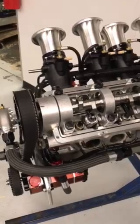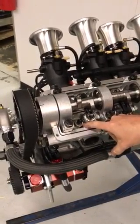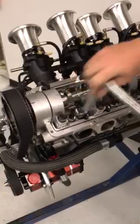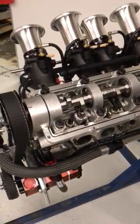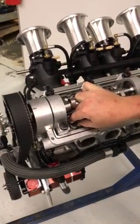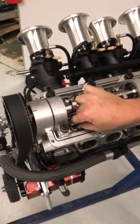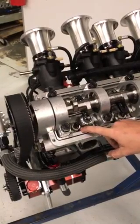we'll require a 7/8" socket to take the jam nut loose on the rocker adjuster tool. You break the adjuster nut loose, and each flat of this adjuster screw is equivalent to approximately 3/1000ths of adjustment. So whichever direction you need to go, whether it's loose or tight, make the needed adjustments per the flats on the adjuster screw.